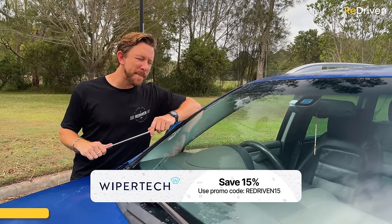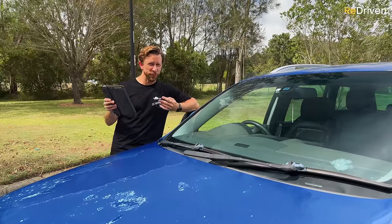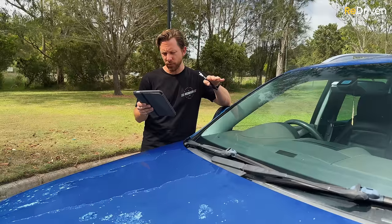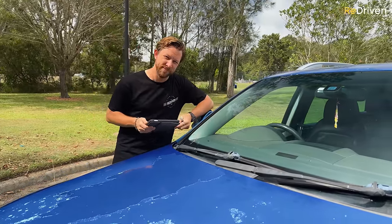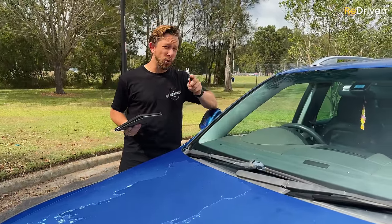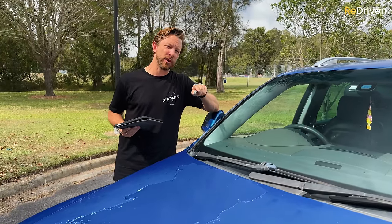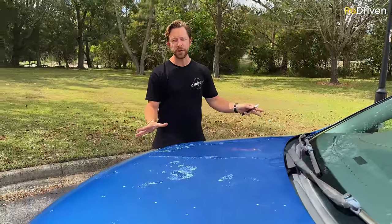The Touareg is also amazing at water retention — and these water retention issues are so bad I have to refer to notes: the sunroof drains can block, the bulkhead drains can block, when you accelerate or brake you can hear water sloshing around, the air conditioning condensation pipe can block, and the rear washer pipe can burst. Best case, you pull out a couple of rubber bungs and the problem's solved. Worst case, water makes its way behind the dashboard, onto the pollen filter, under the carpets, and eventually to the ECU and electronics — which can be disastrous.